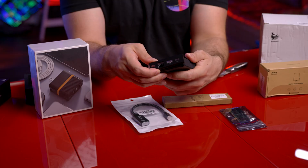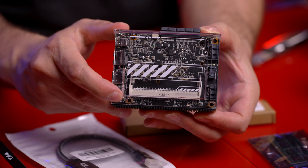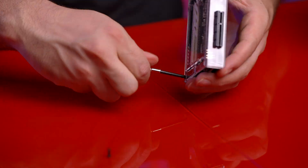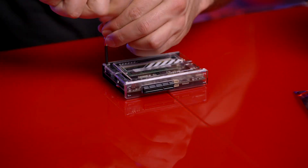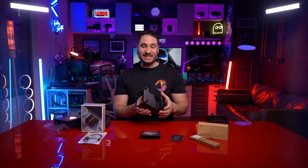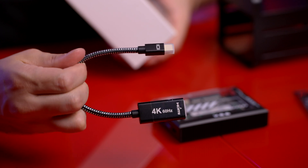To open this thing up you just gently pop off the side like so. Now we're going to unscrew these screws so we can pop the RAM in. The RAM stick is in. This thing is ready to go, but if you do want to use it as a NAS we're going to need to plug in hard drives, which is what the NAS kit is for — that includes a nice little hard drive bay, power adapter, SATA cables, and a mini DisplayPort to HDMI adapter.